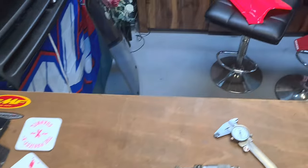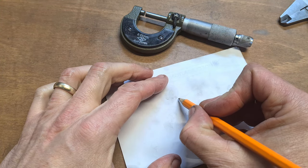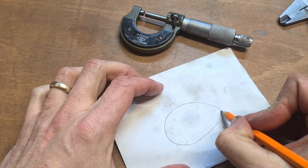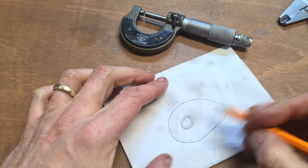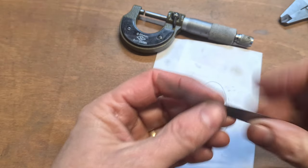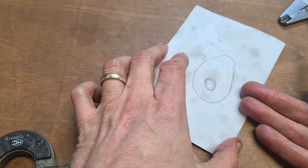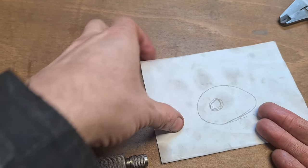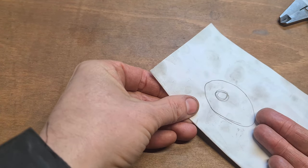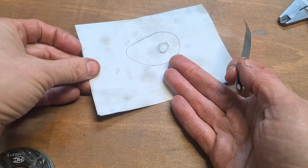All right, let me just stick this tripod down. So here you have, I'll draw you a cam, my best illustration of a cam I can. So we have a cam here, okay? I know it's a little bit wonky, but please bear with me. We've got our feeler gauge. Under here, you've got your cam bucket, okay? As that rotates round, it pushes the bucket down, pushes the valve down to its lowest point, and as it goes back round, it will raise back up and that valve will close, all right?